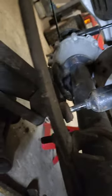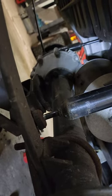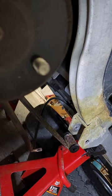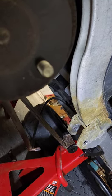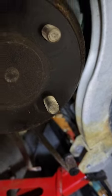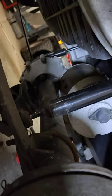When you're doing the rear, you want to do the front part of the leaf spring first. We have a jack stand on each side and a floor jack under the diff. If you take the shock loose on the side you're working on, it will allow the front of the spring to dip down far enough so you can put the bushings in, ream it out, and drill your holes — otherwise you're having to put a pry bar in there and fuss with it while trying to drill holes.